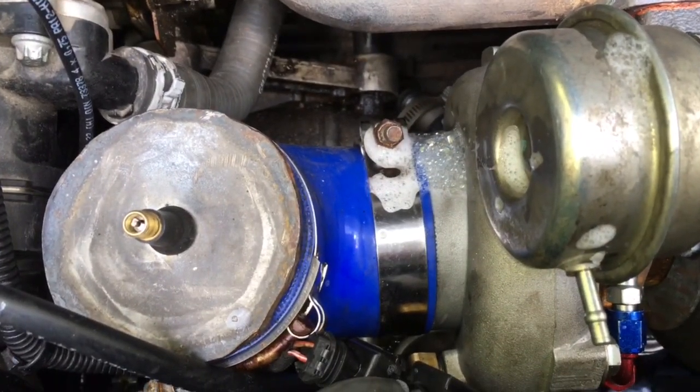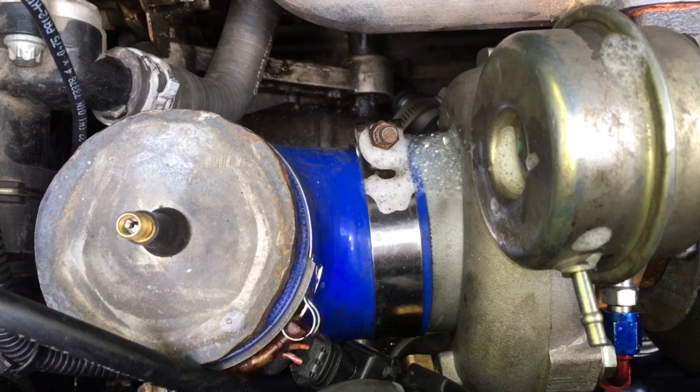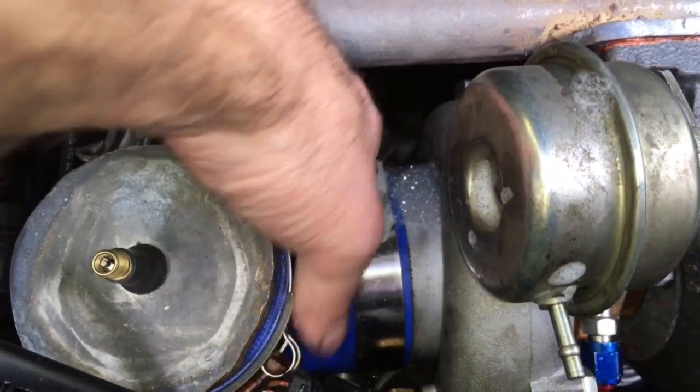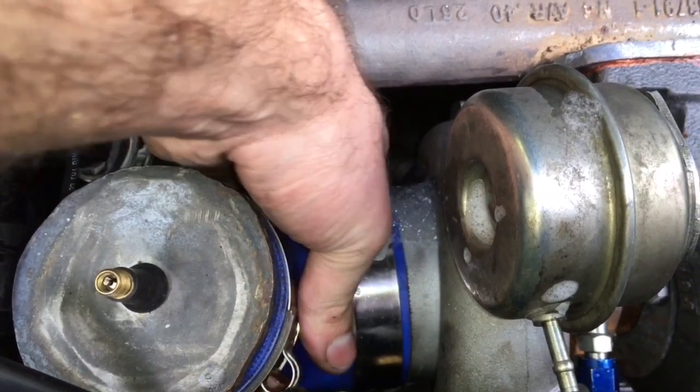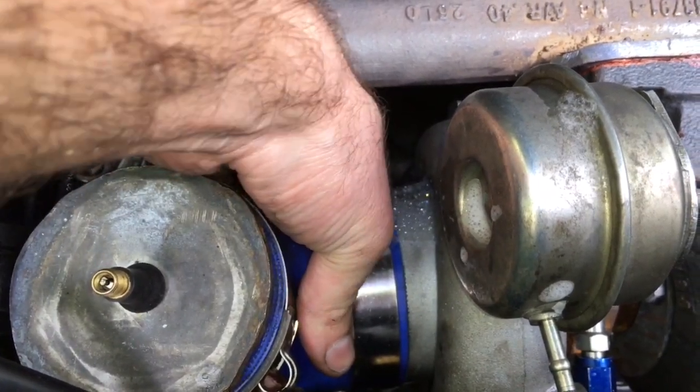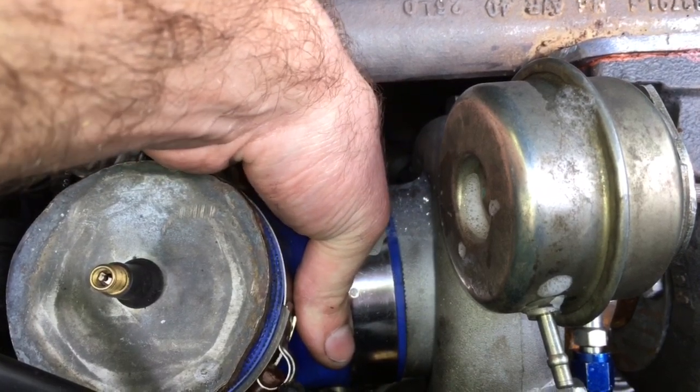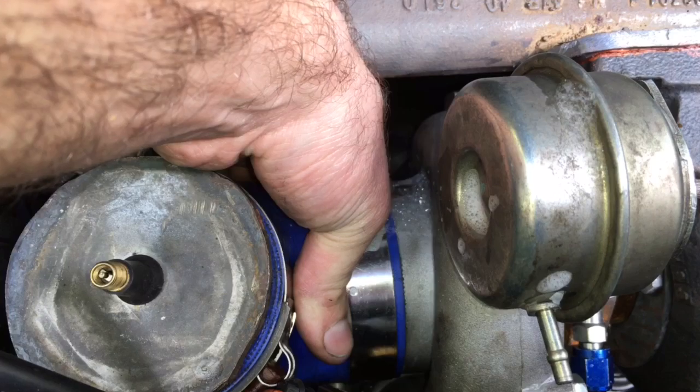After about a minute to a minute and 45 seconds, all the pressure will completely leak out of the whole system through the cylinder head and the piston ring seals. I hope this video is extremely helpful to somebody out there. Apparently it's a really common issue with that orange valve piece — that's the first thing I would check if you have loss of power and seven check engine light codes just like this Cruze. Thanks for watching and please subscribe if you learned something.